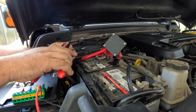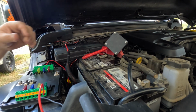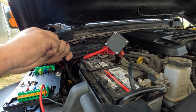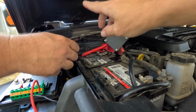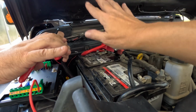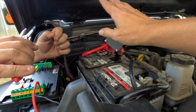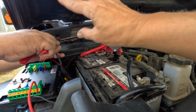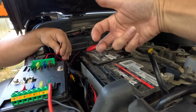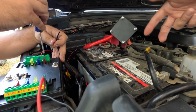In spot number 3, we're actually going to go ahead and put those bigger pod lights on that. So here's the deal. We'll still have that extra switch. We have to. It operates all the different functions of the lights. They have several different functions. Just like daytime running ring, and they go white or amber, and then the light goes white. These were actually running to an inline fuse that ran straight to the battery. That's how they hook up.